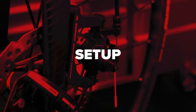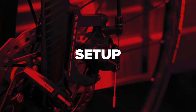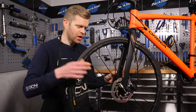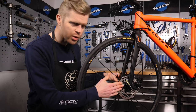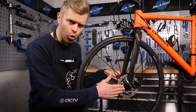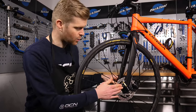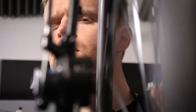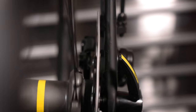Before you adjust anything, make sure that everything on the bike is in order. Check that the wheels are properly seated in the dropouts and also that the disc brake rotors themselves are not loose. You'll also want to check that your rotors are true and are not warped — meaning bent in any way. To check this, simply look down the length of the rotor and spin it, looking for any lateral movement.